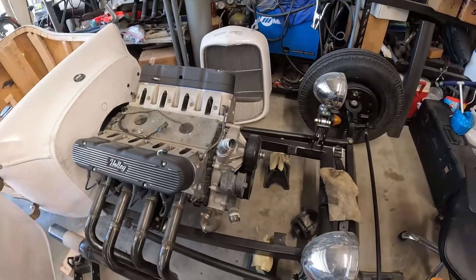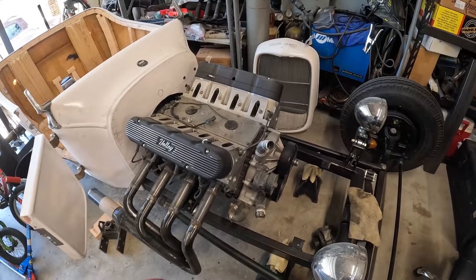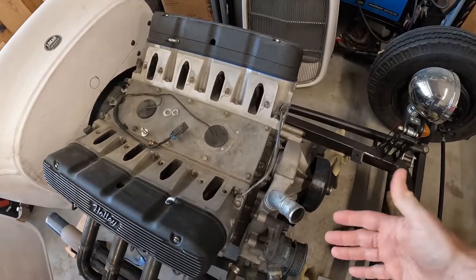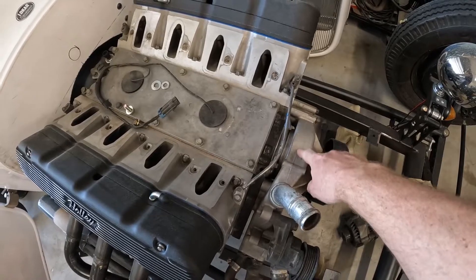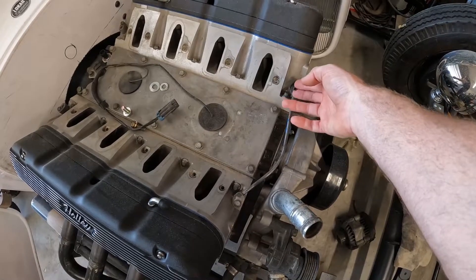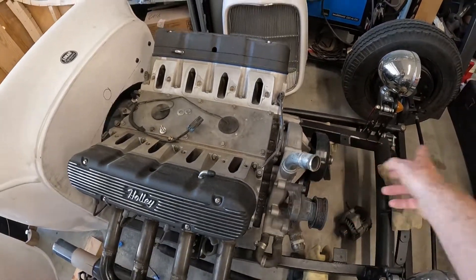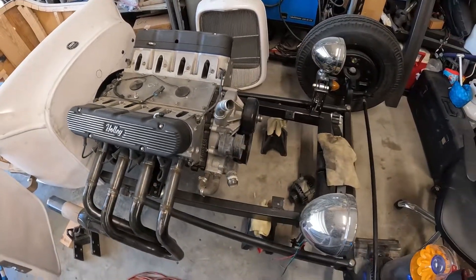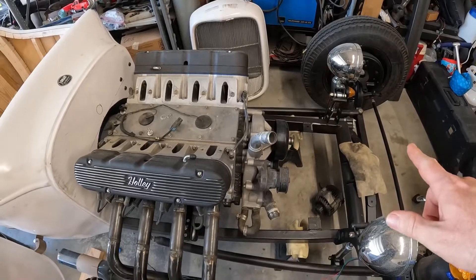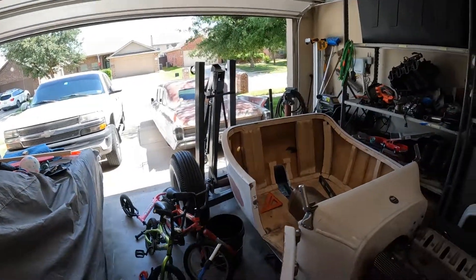Honestly, it's worked fine — I've never had an overheating issue with that car, so I don't know if that's technically correct, but that's how it's done. I think even some of the Holley mid-mount setups have a port there, so it probably still works because it's circulating and allowing this to be maybe under suction or vacuum to pull anything out. But if you're going to err on the side of caution, put it in the radiator up high. In the Cadillac it's been in there for thousands and thousands of miles with never any sort of issue.